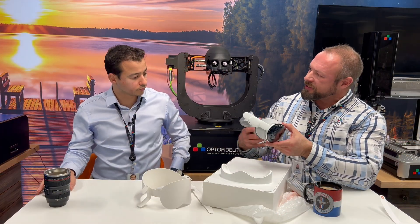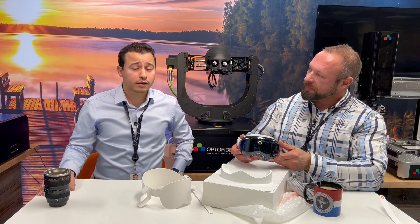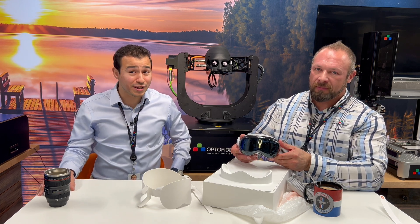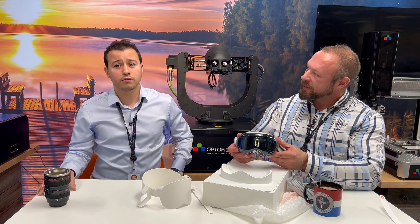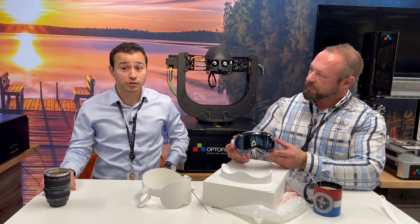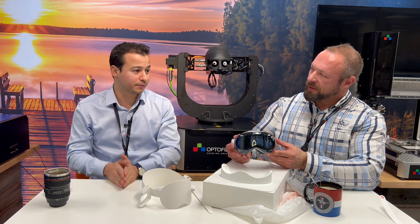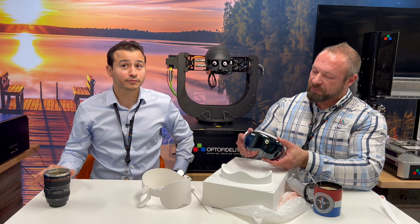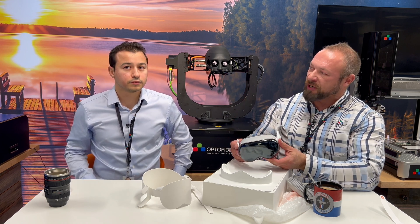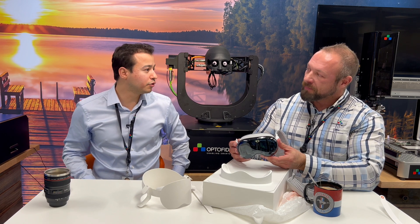So what other interesting things can this device do? For example, this device also has fast eye-tracking based foveated rendering. So what does that mean? Foveated rendering is a feature that enables quick rendering at high resolution only in the region that your eye pupils are looking at. So that means you only get a really precise image where you're looking, but the rest of the image is kind of blurry, and that way you don't need to calculate as much when you render the 3D scene. Yeah, I think this is for saving computing power most likely.